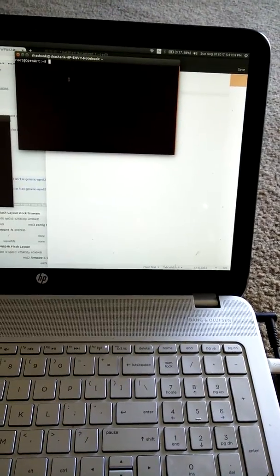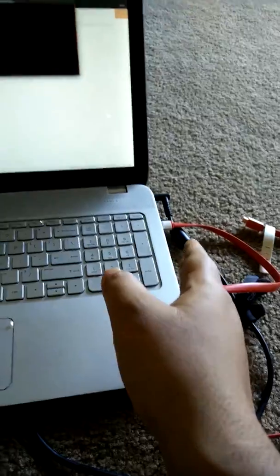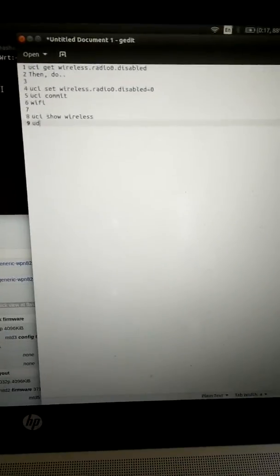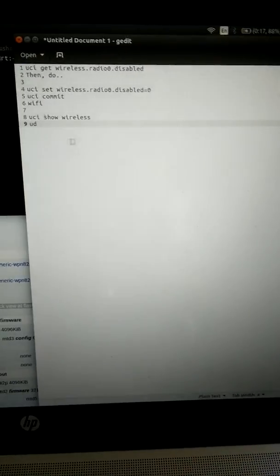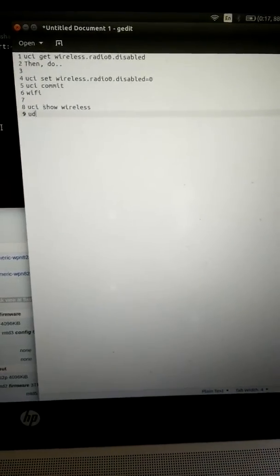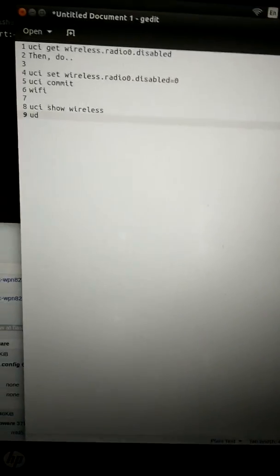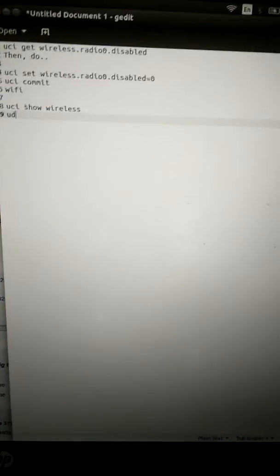If your router has enough space, you can try this. When I connected my Ethernet cable back to my modem and had the internet coming up, I again did an SSH root into my router, and then I did opkg install Luci. Luci is what adds a GUI to this UCI tool. But because my router said not enough space, I couldn't go ahead. This was already mentioned in the forums. But if it is possible, I would recommend you do an opkg install Luci or Luci-SSL.